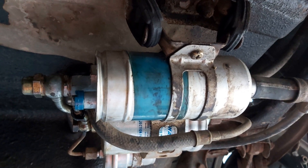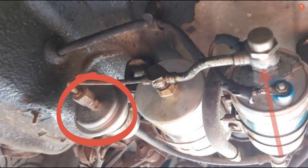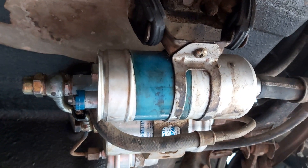The fuel accumulator is connected parallel to the fuel filter. The fuel flows through the pump, flowing at the same time both through the filter and to the fuel accumulator. The hose you see there is the ventilation. If the diaphragm of the fuel accumulator gets ruptured, the fuel is going to return into the line. Here is the picture of the whole unit again.